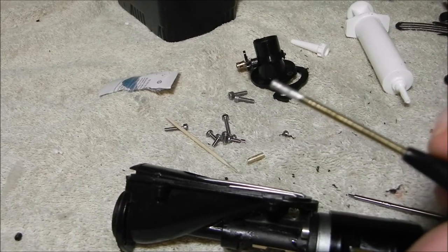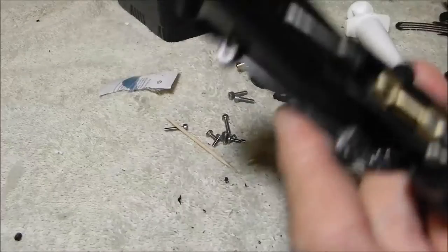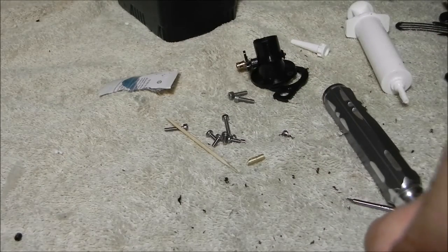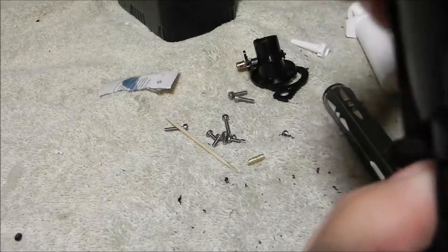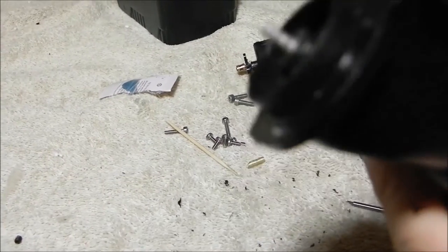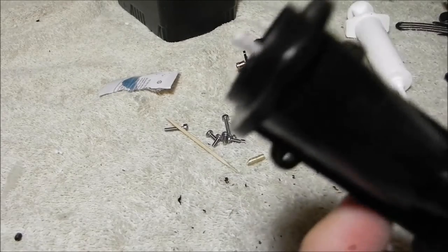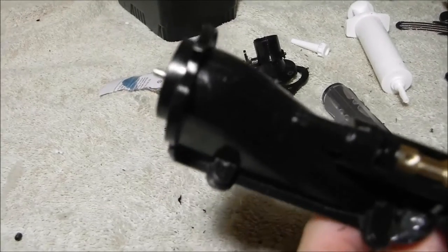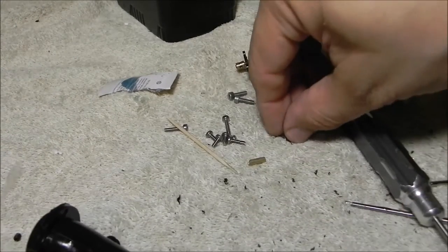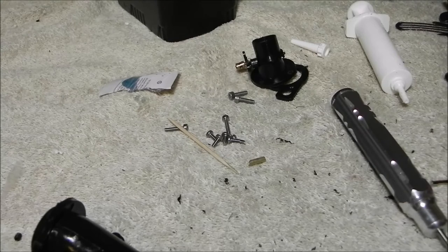The magic of flex cables — I'm back and as you can see we have a slightly cut flex cable. I've actually chamfered a little bit on the edge, and you can see it didn't fray or anything like that. We're going to slide it back and as you can see, that's absolutely perfect right there. So removing 9 millimeters — or 9 to 10 millimeters — would be perfect for most inrunner motors.